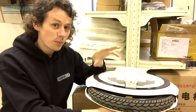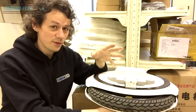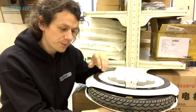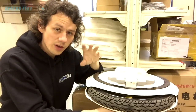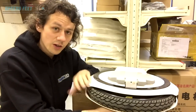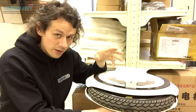Play between those PSI values. The minimum is 35, up to a maximum of 65 on this tire — 55 is good. The other thing to consider: if your tire pressure is high and you're riding on rough ground, your legs are going to have to absorb more of the impact. The softer the tire, the more it acts like a suspension unit.